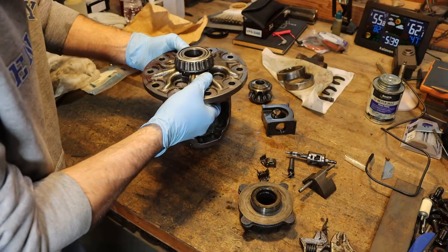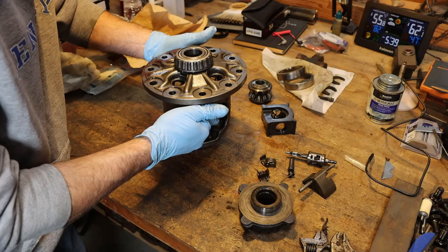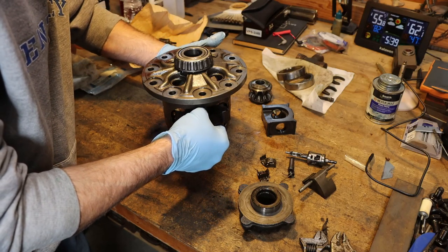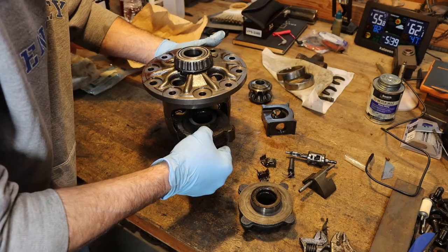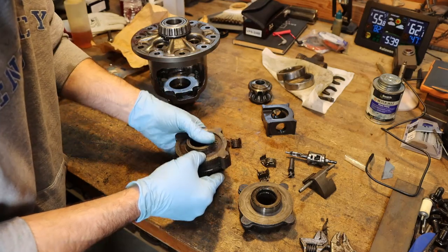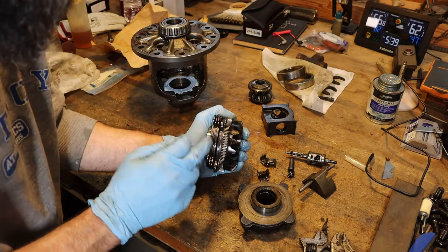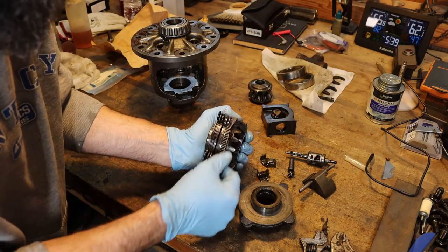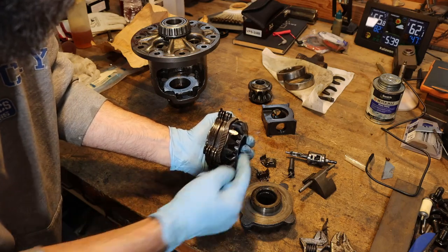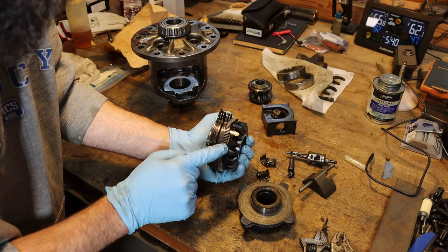It's really the whole component and the way that it works together, but this is the most interesting piece right here. Pull it out. It's much like the other piece, our end bushings and our clutch pack, except this piece has a wavy gear on it. You can see it's kind of wavy because it's a cam gear, really. And the back of the spider gear is cammed to match this gear.